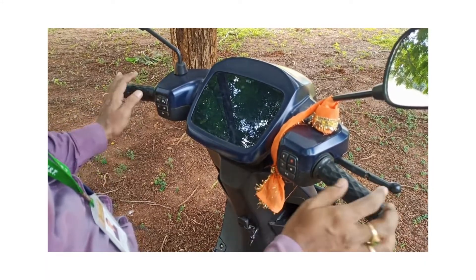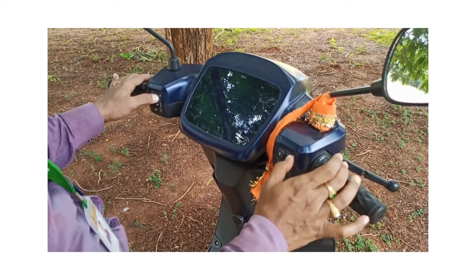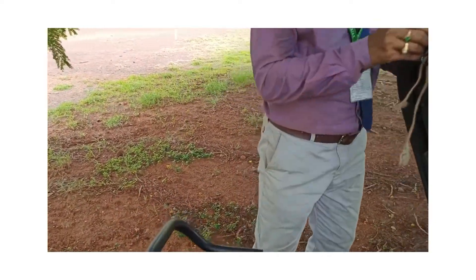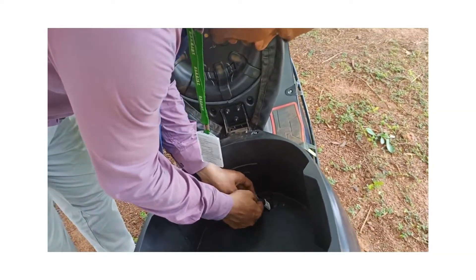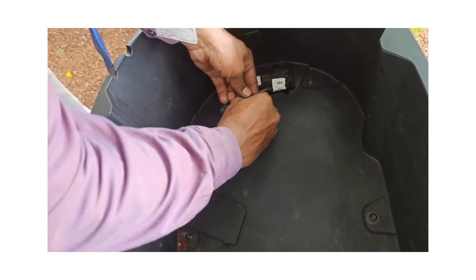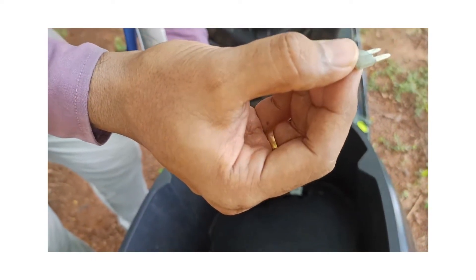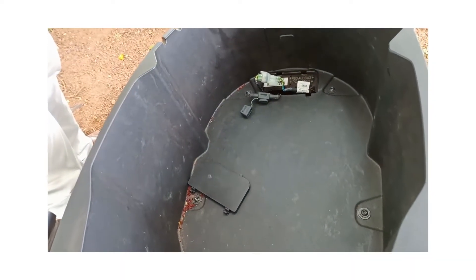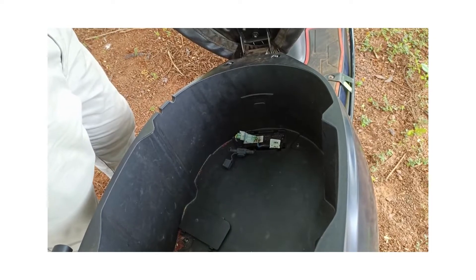After the relay is initiated, restart by pressing reverse and power again for three seconds. If this still does not work, at the bottom of the seat there is a cap — remove it with your hands. Inside you will find the fuse connection; physically pull out the fuse. When you remove the fuse physically, it is automatically reset. This works for cases where the vehicle stops on the road, fails to start in the morning, or stops suddenly.